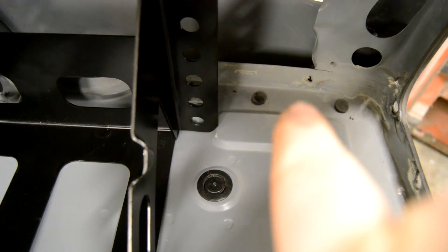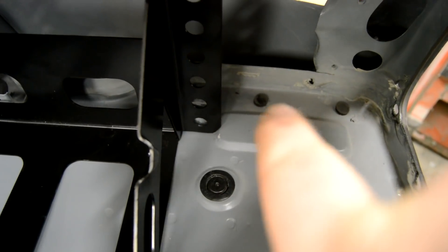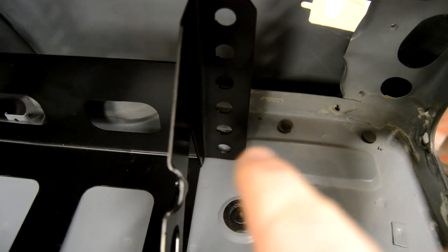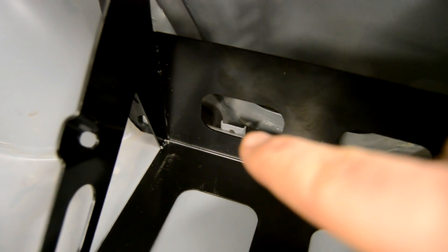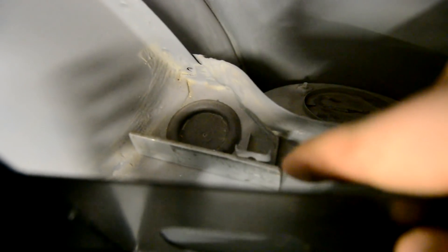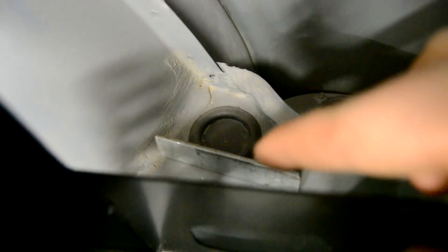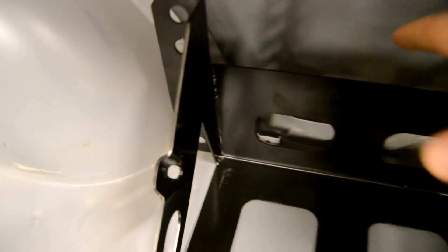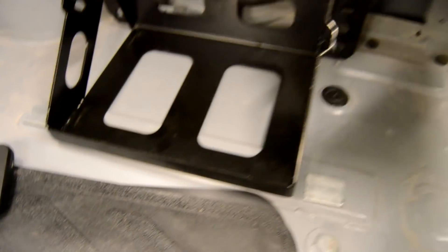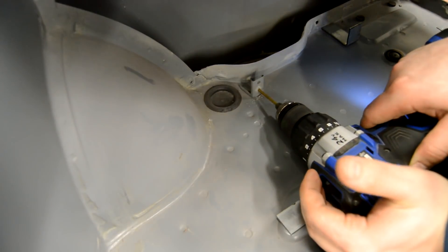However, I do have access back there — the frame rail ends where these spot welds are, and I do have access to the underside easily where these black rubber inserts are. So I have the bracket there flipped around as an L-bracket, so I'll be able to bolt it there and bolt it to the trunk floor. On this side there's a little tab that was probably for an interior trim piece that I'm going to repurpose and bolt this metal bracket to it. I'll drill a new hole and bolt this piece of flat stock, and use that to bolt the bottom side on. Then I still need to weld the tabs on.